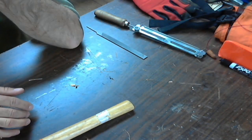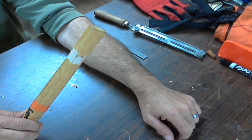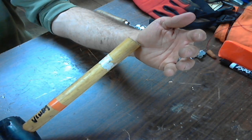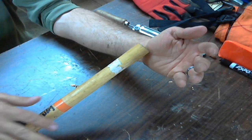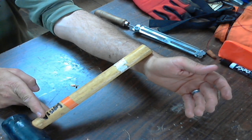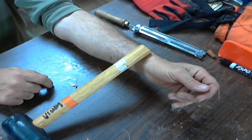Okay, so your tree is over, it's cut off the top, and it's falling down further, in a safe position. So you're talking about if it just falls over and you know there's pressure wood on there, but maybe the branches are holding up, there's some root holding it. I've cut trees, I've had a pole 30 feet long where I cut down here thinking I'm going to work back into the stump, and all of a sudden the whole tree stands back up. It'll come down to the other side. And just make that one cut. And it's not like this is going to be a mystery while it's happening. You're going to feel it, sure.